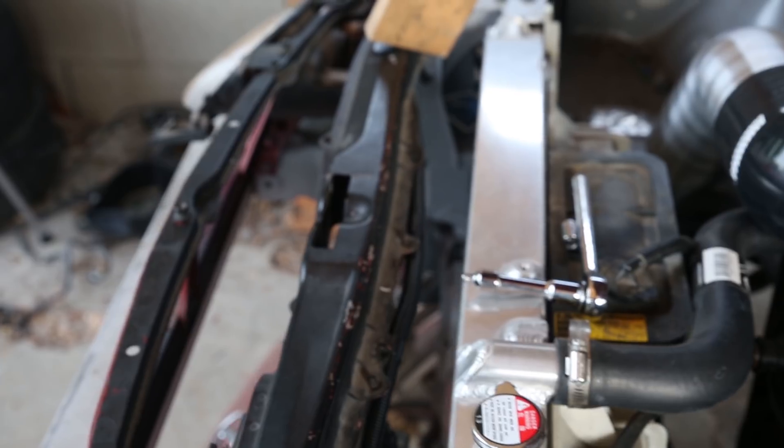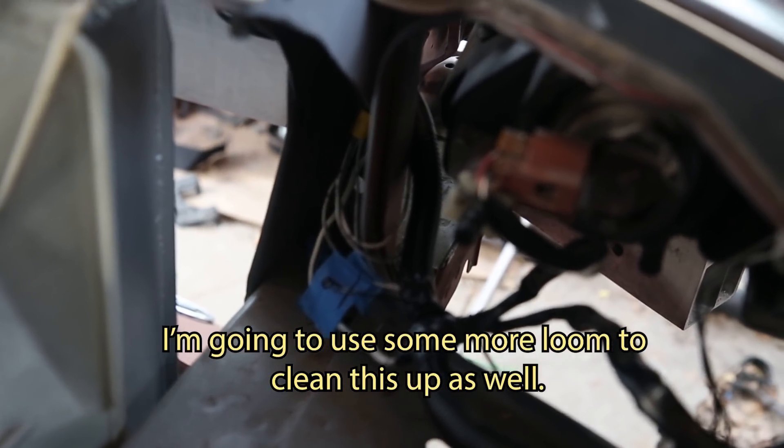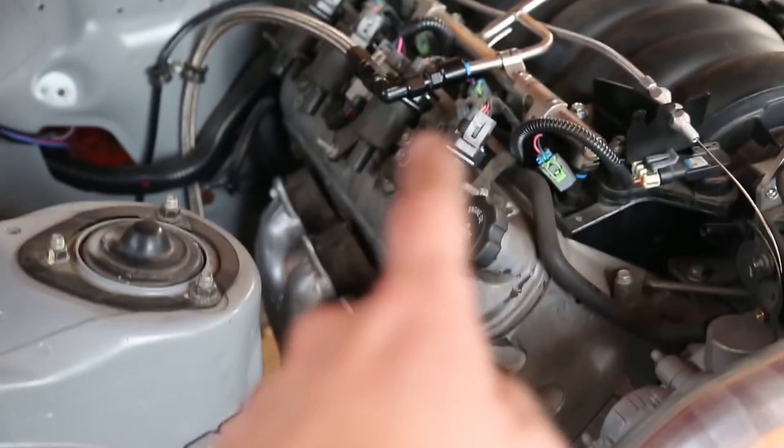So both fans are now hooked up together and they go up along here in this loom behind the driver's side headlight, then it collects all the wires there. It goes up along the top of the radiator support to the passenger side where it collects more wires, and on this side everything is grounded out to the same ground point. It looks like a mess but I've tested it and all the grounds do work. They all go through this little junction area and then from there we go up along the engine bay to the hole in the firewall going into the cabin. All the wiring for the front of the car goes through right here and all the engine stuff goes through that right there.